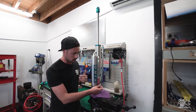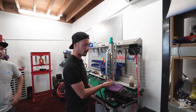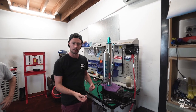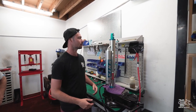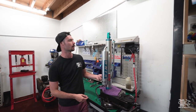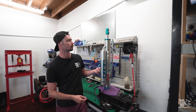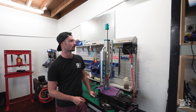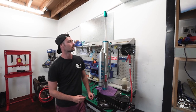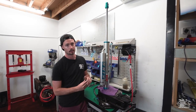Now we'll bring it back down and change this adjustment - wind it in and show the difference. The rebound adjuster's been wound all the way in so it should go a bit slower. It's still got that bump zone there, and then it comes into that next adjustment - it's hit over there and gone up much slower than before. That just goes to show how much play you've got with these bypass shocks to tune them.